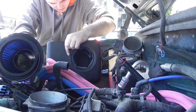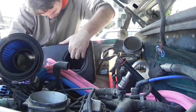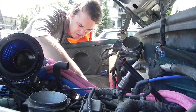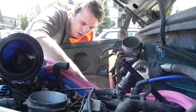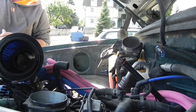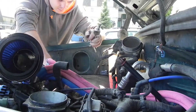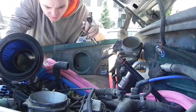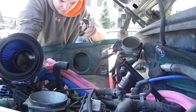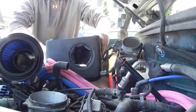Right underneath my blue and pink wires I actually have all my grounds for the truck right there on the inner fender, so I had to remove all of the grounds. There's also a Sky High Car Audio distribution block at the top of the battery that was bolted in there, so I had to unbolt that. That was the start of having a large car audio rig cause struggles with this kit. It's a very inclusive kit and keeps things tight to the truck, which is good, but it caused problems because of all my existing wiring — which in hindsight probably needed to be moved anyway.